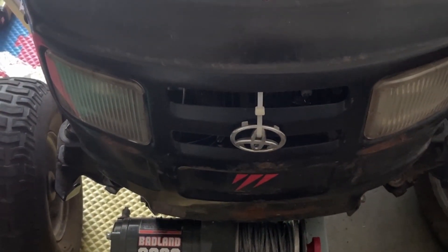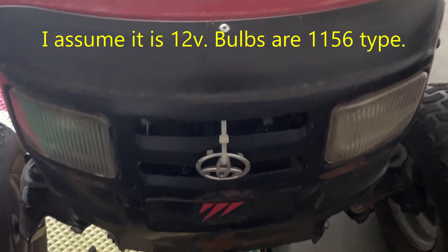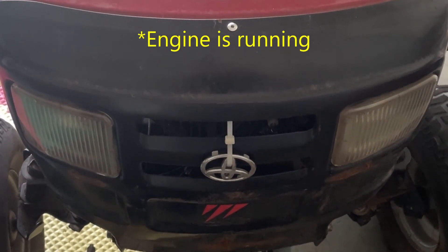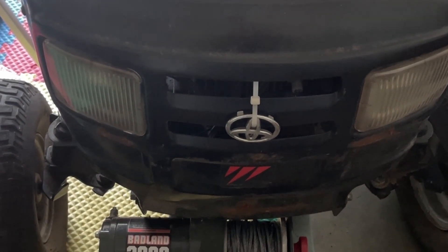What I've got to do is wire the ignition switch in such a way that instead of using the 12 volts from the dynamo, it uses 12 volts from the battery. The 12 volts from the dynamo only exist when the dynamo is on, and it is AC — and these LED headlights only work off of DC.